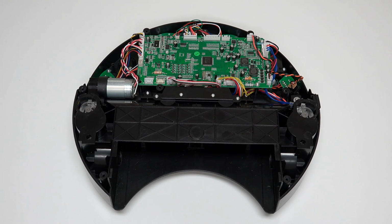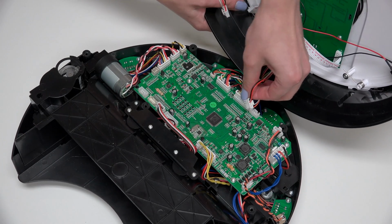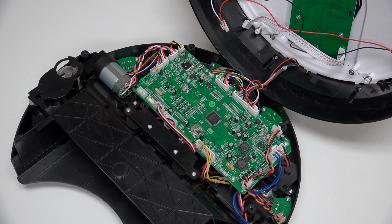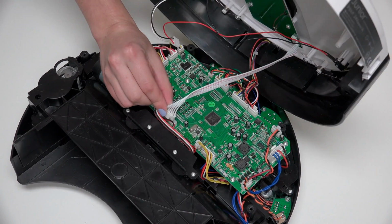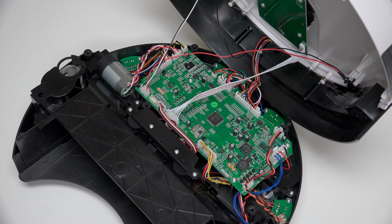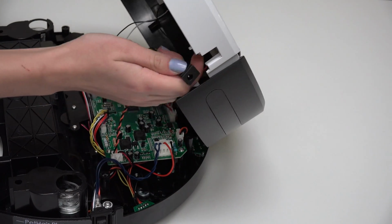Now you're ready to begin reattaching the cover to Junior's mainboard. Reattach all 4 circuit plugs connecting Junior's cover to the mainboard. There are 2 that connect to the top edge of the mainboard, and 2 more that connect to the bottom edge. Remember to slide the power inlet back into its space on Junior's cover.